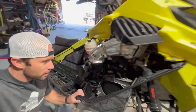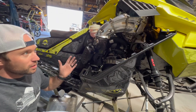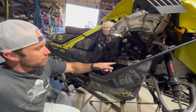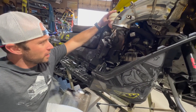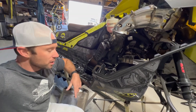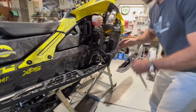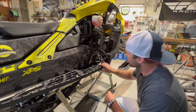As you can see it's pretty clean in here — I really have not worked on this snowmobile. I changed the hood just to have a different color and that's about it. I'm unplugging the temp sensor out of the muffler, unplugging the speed sensor, unplugging the capacitor, and just kind of moving the coolant tank out of the way. Then I'm gonna zip off all the bolts with an impact. There's a little 10mm here that holds the footwell to the chain case cover.